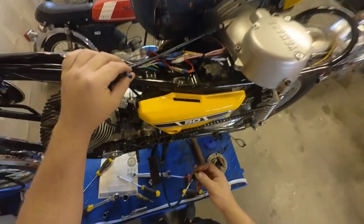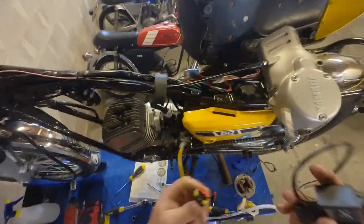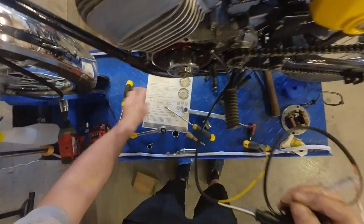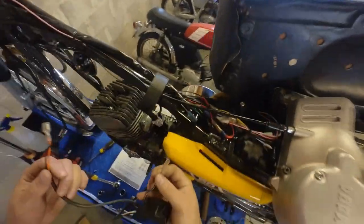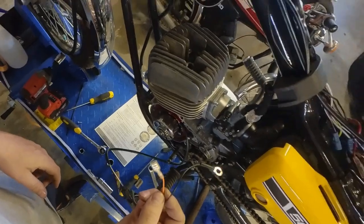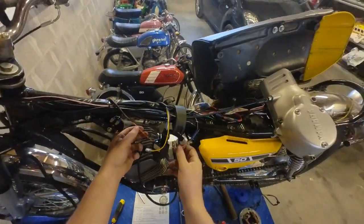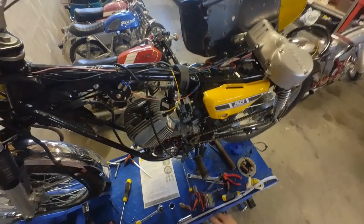I just have to make an adapter for the wire from the CDI to my signal wire here. So this is the base CDI with one curve - I'm just going to see if we can fire this engine with this thing. All we have left to do is connect this with ground and this with signal. Yellow is light. This has to be ground. The black and white is actually to power down - so if you connect this with ground, we turn off the bike. So orange is the signal wire for the coil and black should be connected to ground. I've connected the CDI with the signal wire here with an adapter and the black wire on the CDI is connected to the coil.